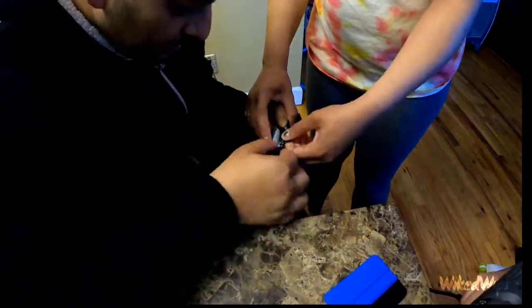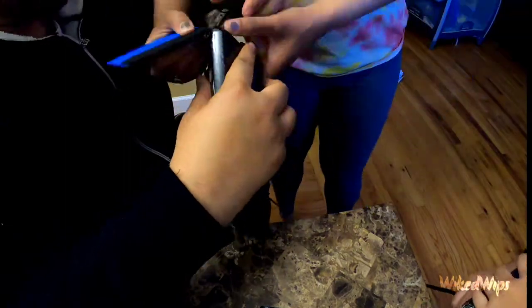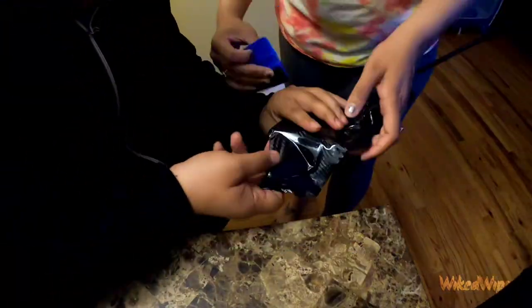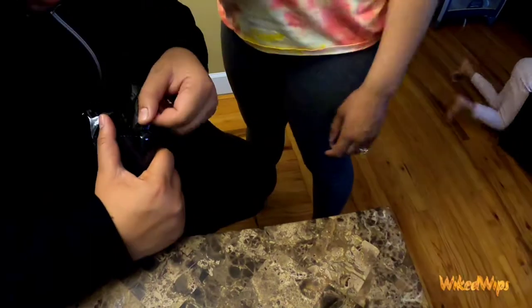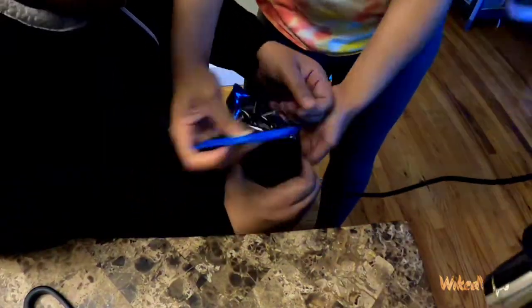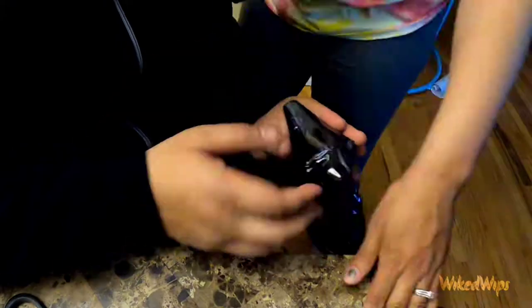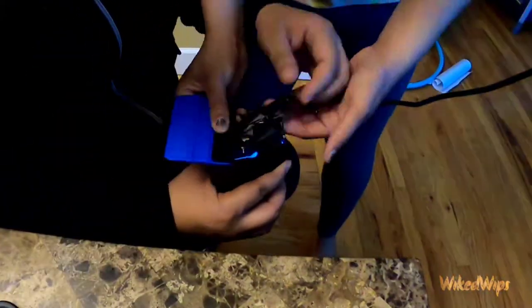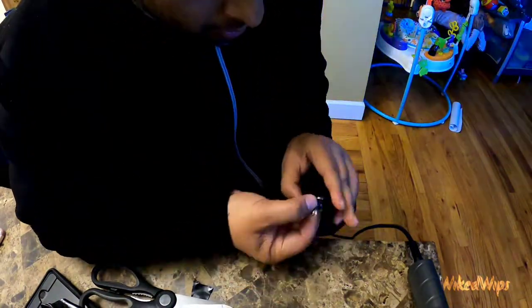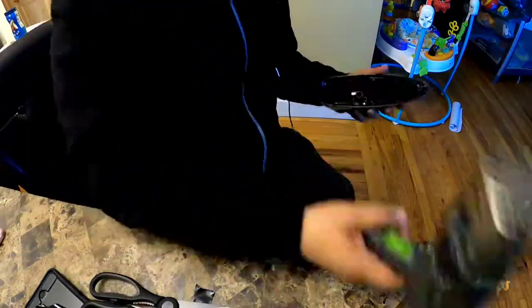As in previous vids, take off the film from the wrap and wipe down the surface of the antenna with isopropyl alcohol — make sure there are no smudges or dust. There are multiple edges on this antenna; it's a small piece so you'd think it's easy but it is not. I had to make a slight incision on the back because there was a huge tension point. Anybody who wraps for a living will tell you antennas are a pain to do. Once you finish the top, fold the edges over the bottom, apply post heat, and it grabs to the bottom.